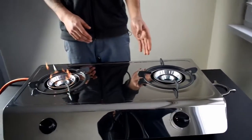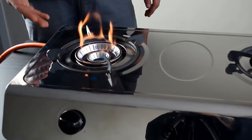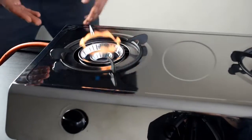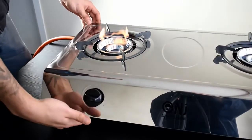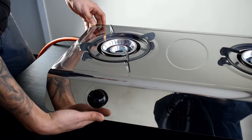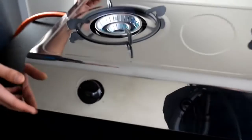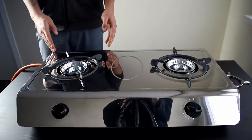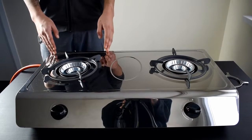This is the proper way to use the cooker. This looks more like a fire, and basically you can regulate this flame until you get that blue-ish flame. You just need to adjust the air shutters underneath the burner until you get the blue flame. This will ensure that you're using the cooker properly and safely, and you will also get low consumption.